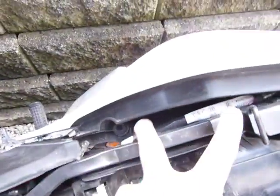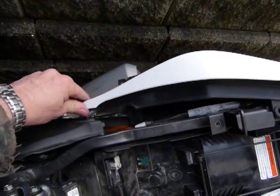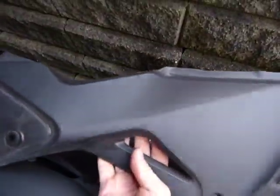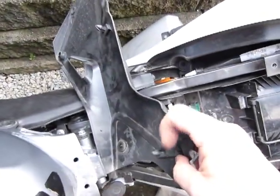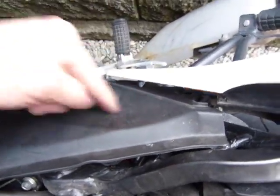You need to remove these two bolts because you need to pry out the corner of this fairing. You don't have to remove this piece entirely — you just have to remove a corner of it, because this piece is the next piece underneath. This one here has on its back side little things that kind of engage into the gas tank, and that part also joins these two body panels together, so you need to loosen those ones.